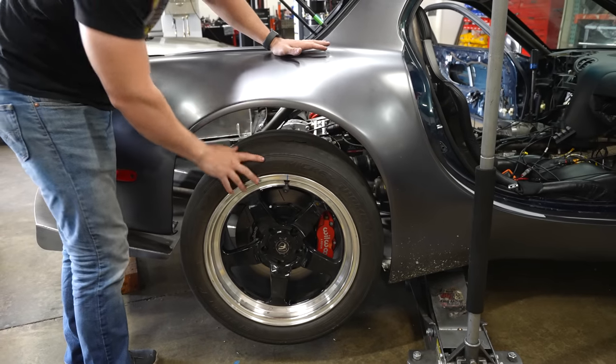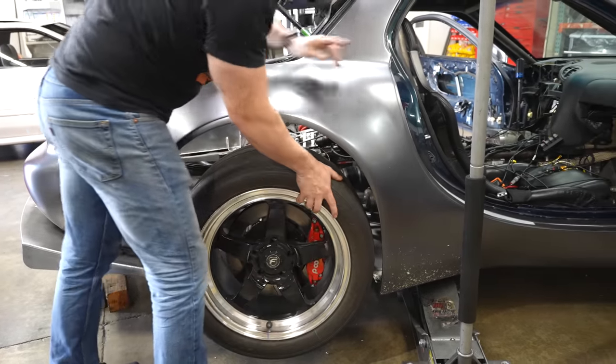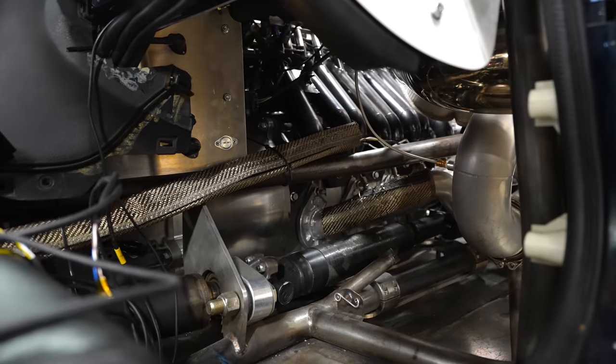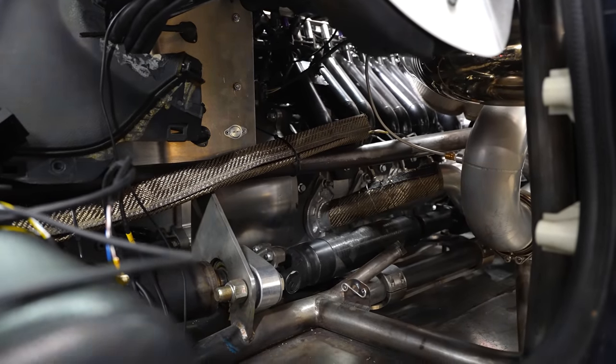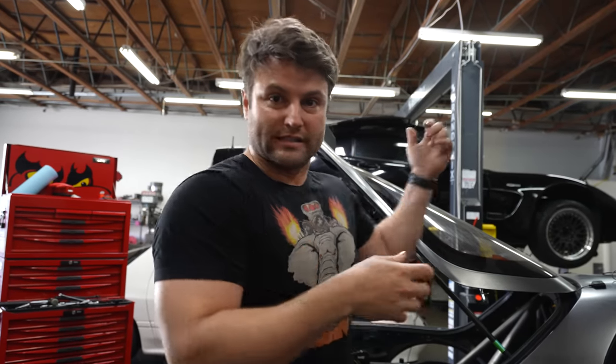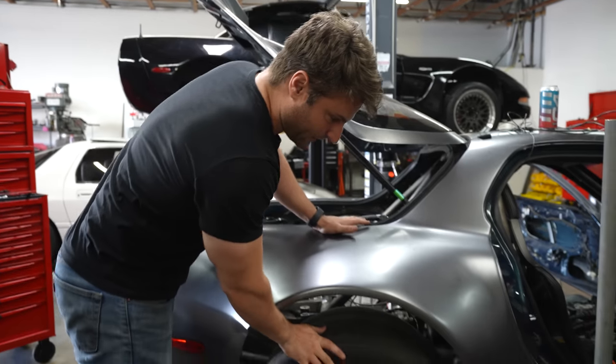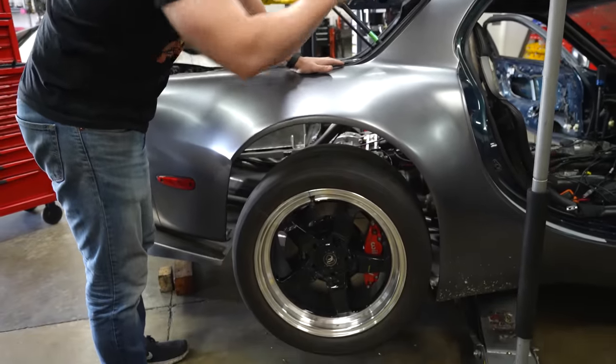And so you can see that once it hits, you can actually see the all-wheel drive system spinning the wheel slowly, spinning the wheel slowly, and then. Oh, it's actually applying all-wheel drive. I have it at zero at rest. And so that's how accurate this car is. Each of the four wheels gets a speed sensor that is extremely accurate. It's meant to be accurate because it has to work for ABS. It can tell the position of the tire almost like the CNC can tell the position of its drill. It's really impressive. And so that's the first half of what I wanted to show you guys, is we now have full ability to do all-wheel drive dynamically based on wheel slip.